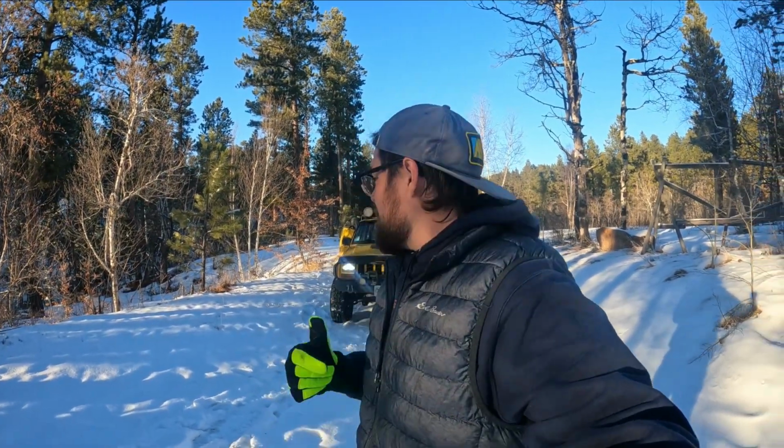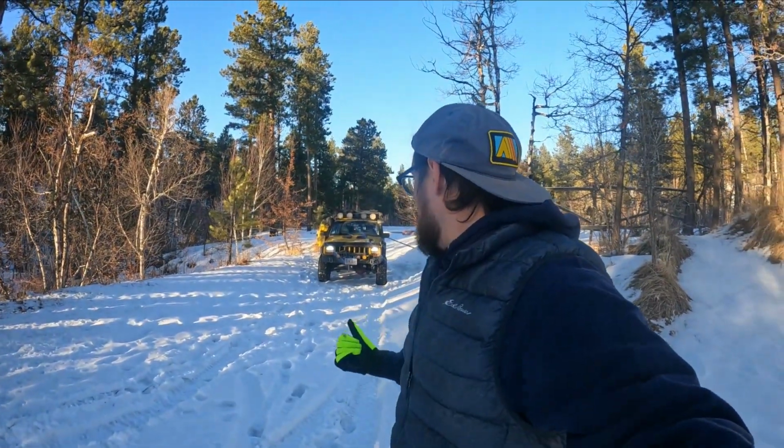There you have it. That was the Case Suspension DB Electrical upgrade alternator with the Jeep cable kit. The load we put on it was pretty massive, and it still was charging the vehicle, it just was not happy. It was at like 11.9 or 11.5 volts at some points. Normally at idle it's at like 13.4 volts and it holds there pretty strong. So overall, I'm happy with the upgrade. It's charging, it handles a pretty solid load, and it's going to keep me on the trail.